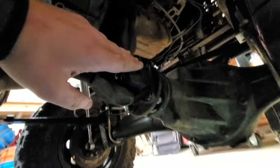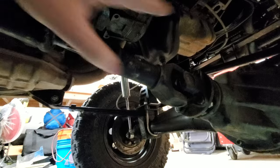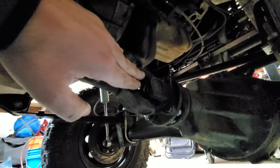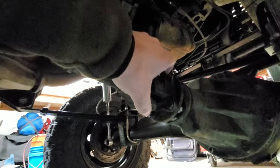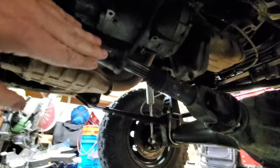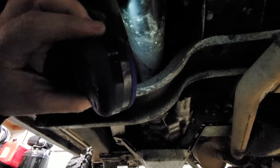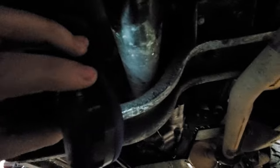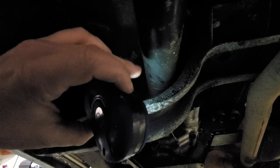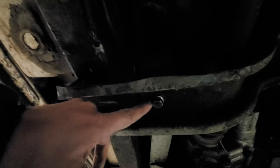For now I feel comfortable just putting another spacer right here to get some spline back. It's definitely not the right way to do it — we do need a new drive shaft in the future — but we're under a time crunch and we're going to miss some events if we don't get something worked out. If we run it like this and the passenger side drops, the drive shaft is just going to slip out. That is really close to the cross member — you can see marks on the drive shaft right there where it's contacting when the passenger side droops down.